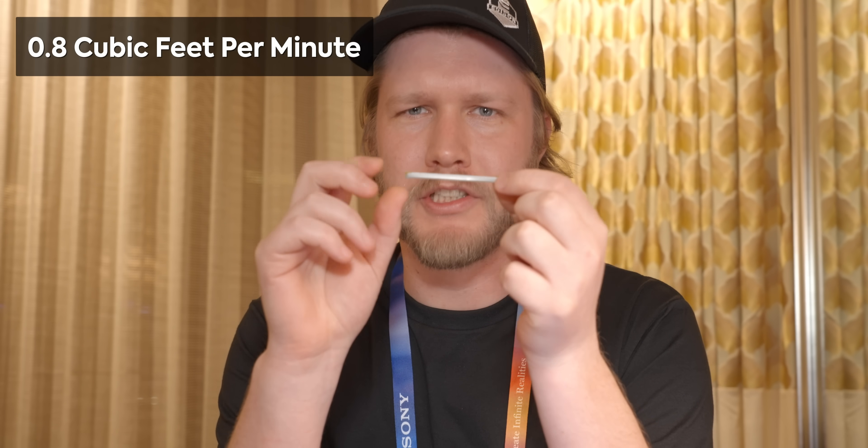This setup right here is capable of about 0.8 CFM, which is similar to what you would find in a typical thin-and-light laptop fan. I did ask them if it's possible to just throw more voltage at the problem and get more airflow out of it, but it turns out that the limit is actually the breakdown of the air — at a certain point this stops ionizing air and you get lightning in your laptop, which is obviously not very ideal. So physics has them a little bit constrained, but fortunately space doesn't necessarily.